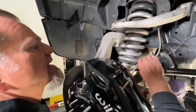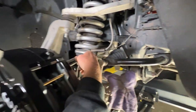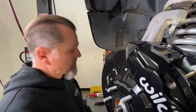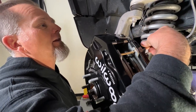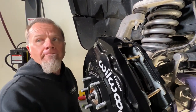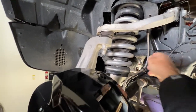We did a little R&D and tested fitment on our brake line situation — everything looks really good. This is a steel braided brake line. Factory is rubber, and then hard line down at the caliper. We should feel a little less compliance and more positive pedal feel with this steel braided brake line. Oh, absolutely.